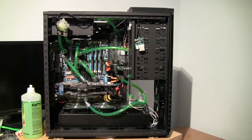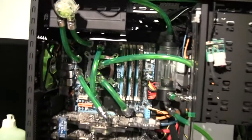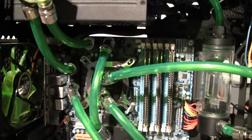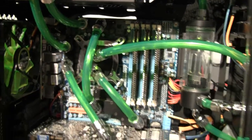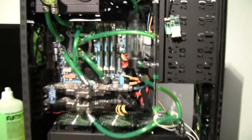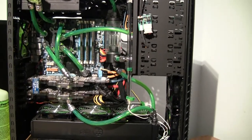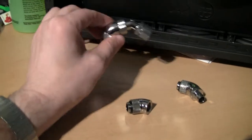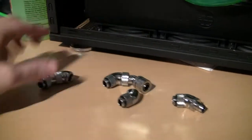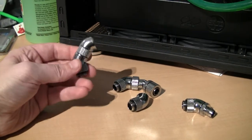About six months have passed since I finished this build and I would like to make some improvements to it. One of the challenges I encountered originally was the tubing runs. This was mainly attributed to the fact that I cooled everything from CPU to chipset to cards, and had a lot of connections very close to each other. It was almost impossible to make direct runs because tubes simply kinked, so I had to make quite complicated tubing runs which I don't like. To improve this, I would like to use 45-degree adapters and combine them with other angled fittings to make smooth 90-degree turns, which wouldn't cause kinking unlike sharp 90-degree fittings.